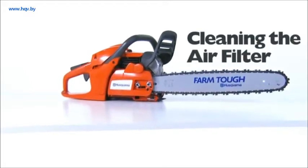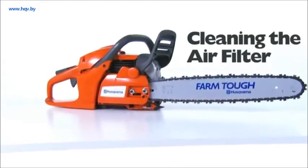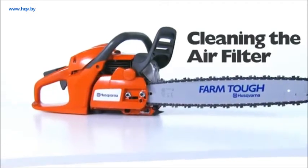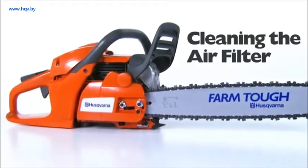The air filter must be regularly cleaned to remove dust and dirt in order to avoid carburetor malfunctions, starting problems, loss of engine power, unnecessary wear to engine parts, and excessive fuel consumption.